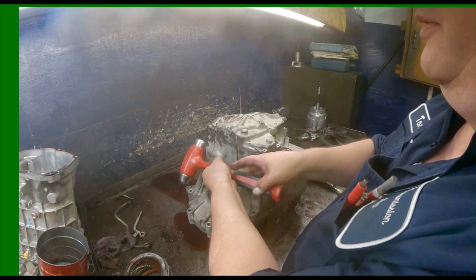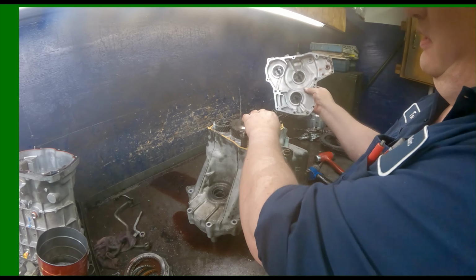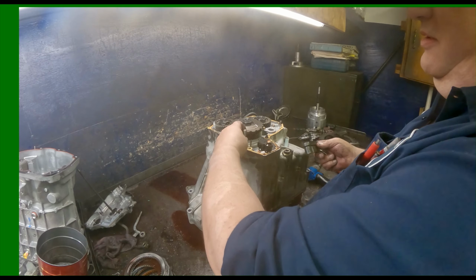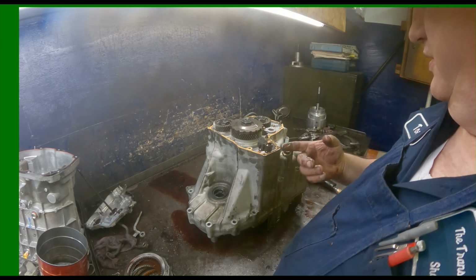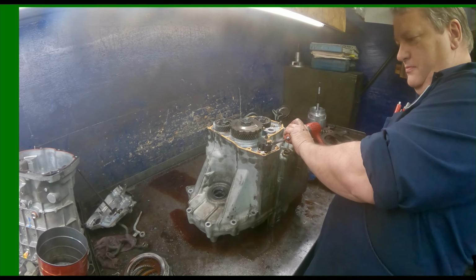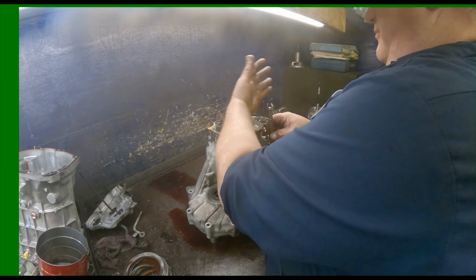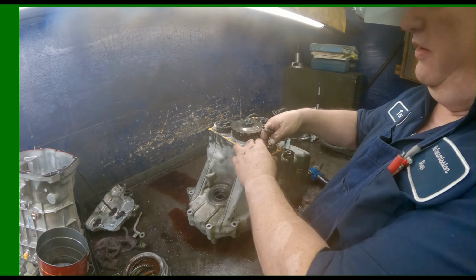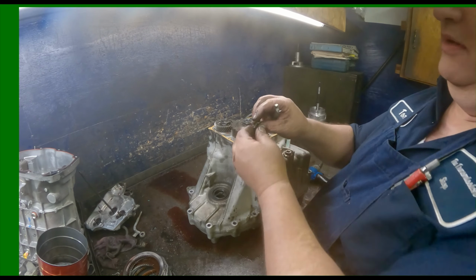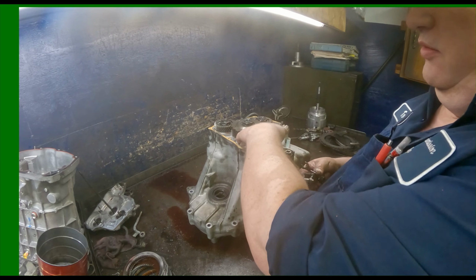There's several spots around here where you can tap up. Let's go ahead and leave these tubes in there for right now. Here's our park actuator, pivot pin, and return spring. On here, there's another keeper. I'm gonna bend that tab up. This one's a 10 millimeter. We're going to pull it all the way over. Bolt on our keeper. We got our return spring, sits on the back, loops around this little pin that goes through here.